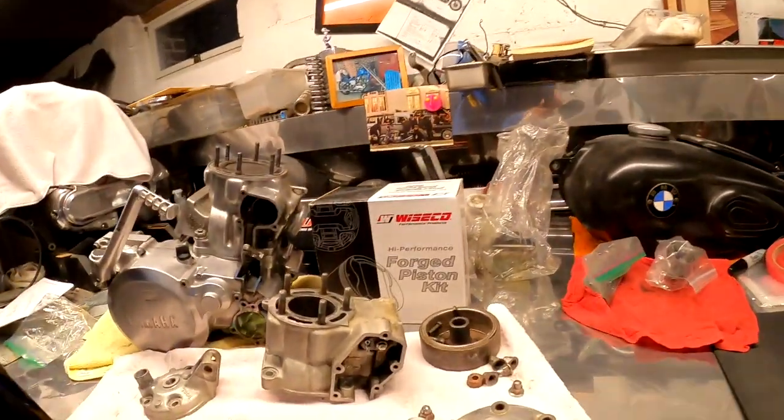We are working on the WR, and we're actually going to get ready to split this motor today. So we'll be able to double check 100% that we have our wide ratio fourth and fifth gear. So once again, it should be a taller gear. We should get some nice top speed out of this bike, topping out around 90 as opposed to 70.